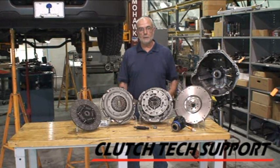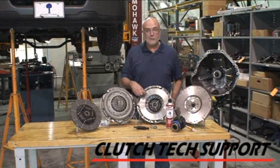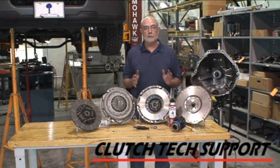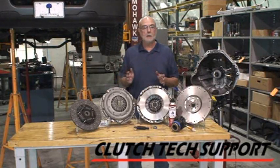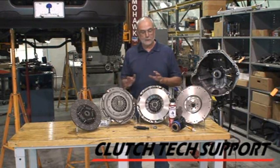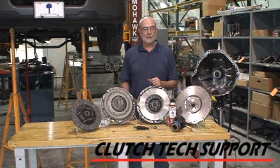There's been a little bit of confusion in the field about whether you have to do anything to install the self-adjusting clutch. There's one thing you have to do — clean this friction surface with some type of brake clean or alcohol, something that doesn't leave any residue behind. No solvents from the solvent tank. Don't dip this part. There's no need to take this clutch cover assembly to the solvent tank. Also very important: don't bolt up the clutch disc and flywheel because you heard you had to adjust it before installation. Not required. Don't play with it on the bench. Don't test it. Put it in the vehicle, make sure it's bled, and enjoy that new self-adjusting clutch.